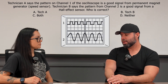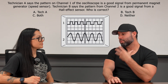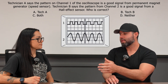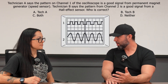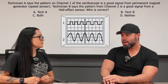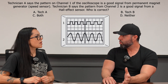Although it is a transmission test, transmissions use sensors and are all computer controlled. So we need to understand the differences between a digital type sensor and an analog sensor. The permanent magnet or variable reluctance sensor generates a nice AC sine wave. A digital sensor like a Hall effect sensor produces a digital square wave — oftentimes zero to five volts, or zero to 12, whatever it is. They're checking to see if we know the difference between the two, which is important for testing them properly.